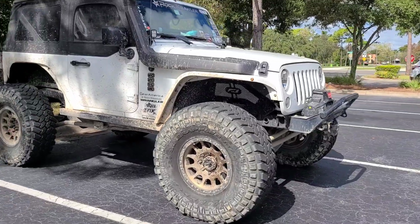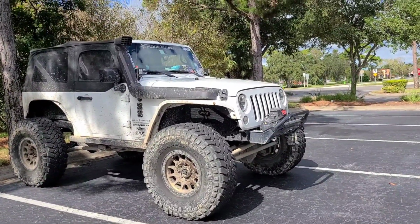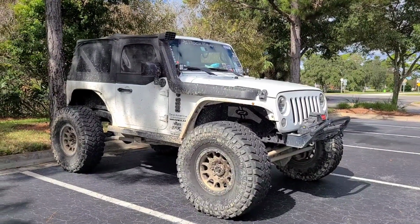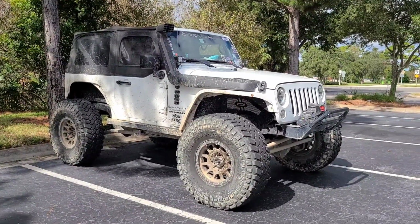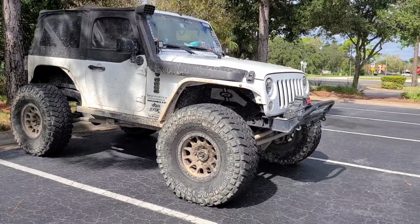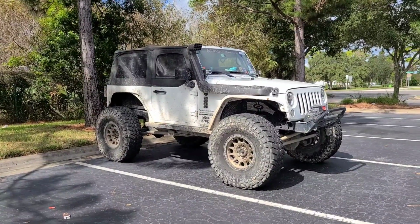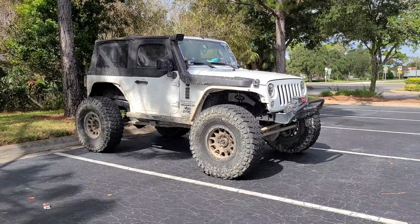But yeah, so wear items, replace them all. I would do a selectable rear locker. Super happy with the auto in the front. That's about it. Honestly, not too many regrets, but those two were the two that stuck out to me a lot, and the Trackbar Bracket. I would have gone with a different Trackbar Bracket if I were to do it again. But all in all, junkyard axles are not a bad way to go.